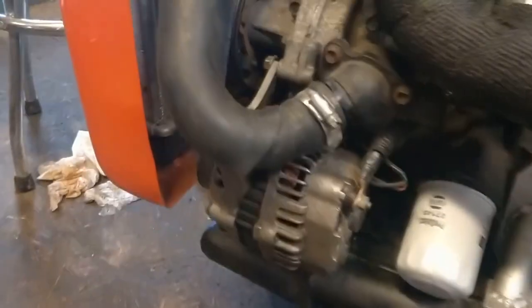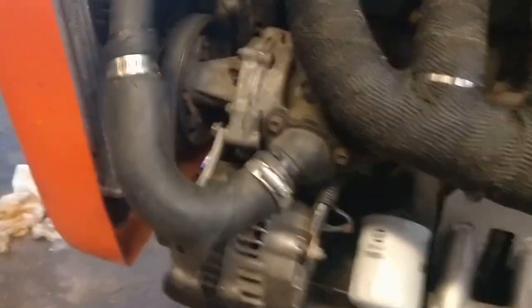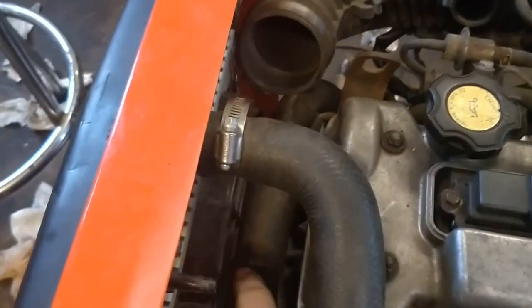I welded the insert in for the factory O2 sensor right there, and I'm going to stick the wideband into the turbo for now — that's meant for my truck but this gets it for now. I rerouted the radiator hose up because I didn't feel like making a new outlet. It's lower than the top of the radiator so we shouldn't have an air pocket. I also moved the fuel pump there instead of under the fuel tank since it'll be hot near the turbo.